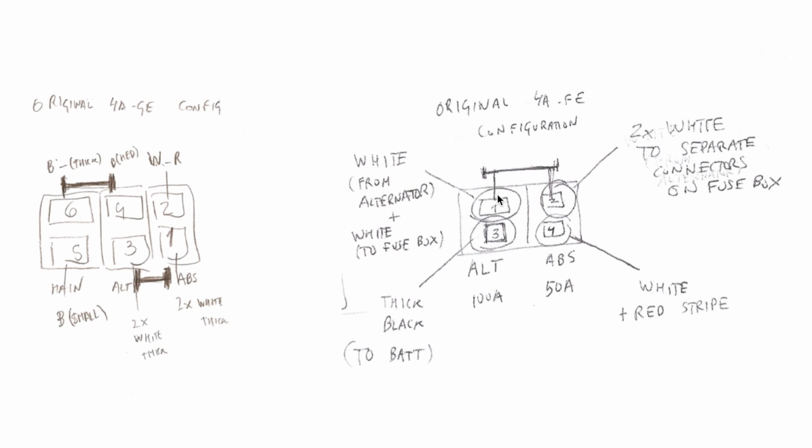The end result is that when you have current flowing from pin 1 to pin 3, for example, through that fuse, if there is a short circuit somewhere, the current will be much higher than 100 ampere. That's why stuff burns. When people take a fuse and put in a piece of, for example, foil or tobacco wrap, what happens is that there is not this protection. There is not that wire specifically designed to burn out in face of that high current. But in this case we have a working fuse.